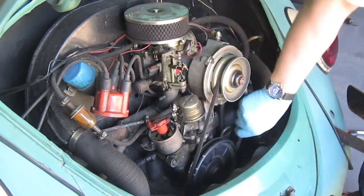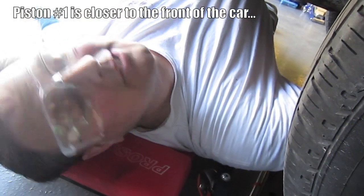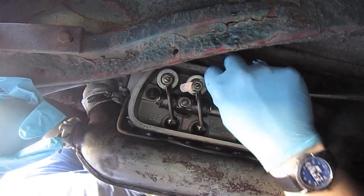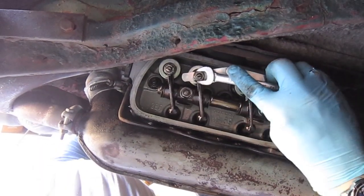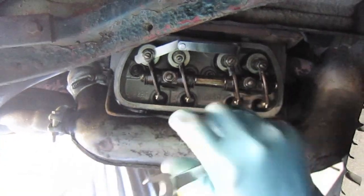Time for piston number two. You'll notice this is bottom dead center — in other words, 180 degrees off of top dead center — and the distributor rotor is aimed at piston two right now. I've already loosened the lock nut, got the feeler gauge in there, got her where she wants to be. Going to tighten the nut down by hand as far as it'll go, and then switch to the wrench. Sometimes what'll happen as you loosen the lock nut is the adjusting screw will come with it. If they get stuck together, not a big deal — just tighten the screw back down. You may actually have to hold the screw in place while you tighten it. It can be tricky, but it's totally doable.